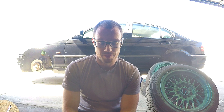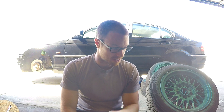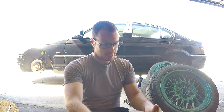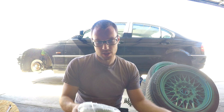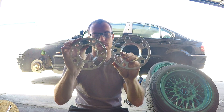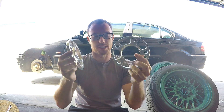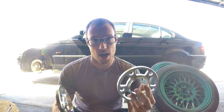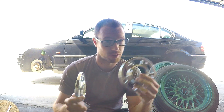Wheel studs are pretty simple — you'll see the DIY. While I was there I also picked up a pair of spacers to push those front wheels further out so I can get the suspension clearance I need. I picked up a set of their 12-millimeter super light spacers to put in the front of the car, which should give enough clearance to run the wider Tire Rack Motorsport wheels I like to run up front.